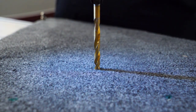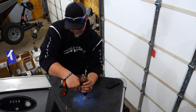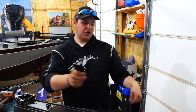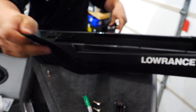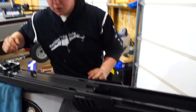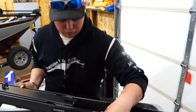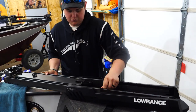The next step is we've drilled the holes and now we have to through-bolt the scissor bracket on. But before you do that, you want to make sure you add this strap. All you're going to do is run it up underneath the scissor bracket and let it sit loose on the scissor bracket for now. Then grab your bolts, find a hole, and try to figure out where your holes are.